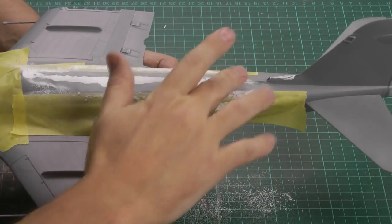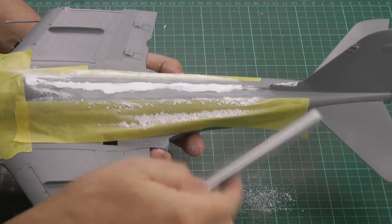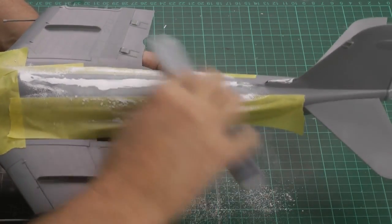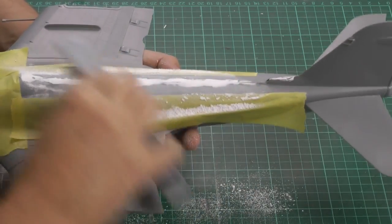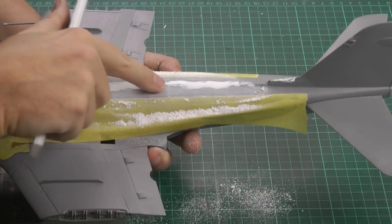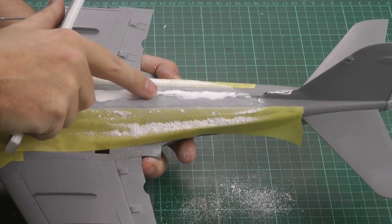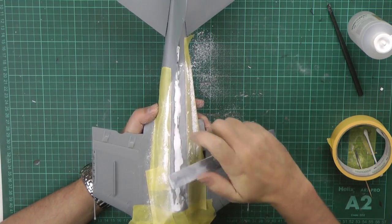Okay, so when you look down at it and feel it, it should be smooth, and we've still got crevices and lumps and bumps down here. Obviously, we need to get lower. But what you should start seeing is centres of high areas popping through the filler. So for instance, we just do this area here. You can see we've got a little bit of a step coming across, because you can see the difference in the height there. But feeling it, nice and smooth.